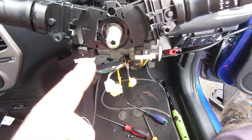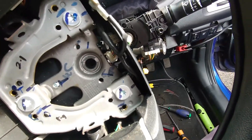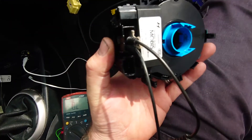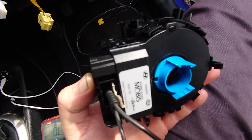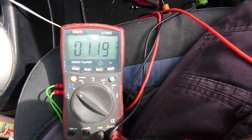For a bit of ease on the video, I've taken the clock spring off. You just undo the nut in the middle of the steering wheel. I've marked it with some white paint against the spline — the steering wheel was straight. I also put a little white mark on the clock spring because you shouldn't move them too much even though this is probably going to get changed. On the back of here, I've pinned into these two terminals using the pin-out stuff I've got, and I've had to put a bit of cardboard in there — I'll show you why in a second. It does have continuity. The maximum permissible range, according to Hyundai, is 6 ohms.